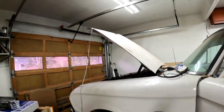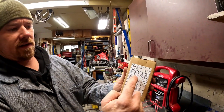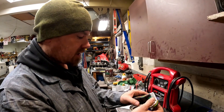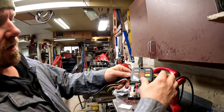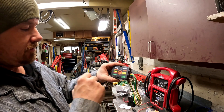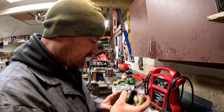I had to go through several belts but I got a belt on, fuel filter on. I ordered one of these trailer wiring conversion deals - I'm sure this car had one factory but it's been long gone. These are pretty basic. You have everything coming in then everything going out, so your brake and blinker are on one set of bulbs. That needs to be wired in.